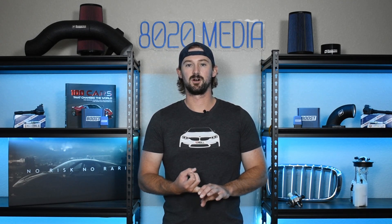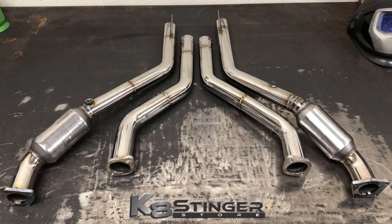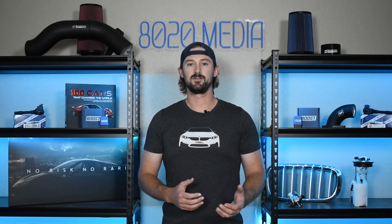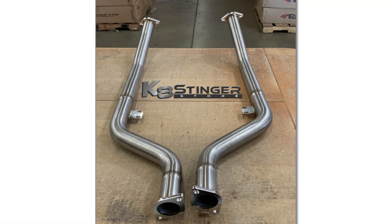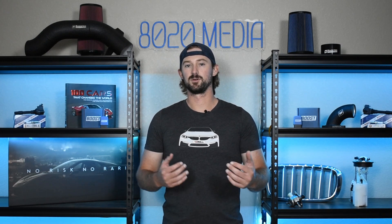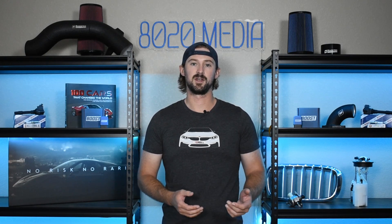You're also going to take a ton of pressure off of the turbochargers, making them more efficient and therefore making more power. The Stinger has two sets of downpipes — primary and secondary — and they do house catalytic converters. Removing them is not legal from an emissions standpoint unless you have a race-specific vehicle. However, going completely catless is going to give you the biggest power gains. There are also options for high-flow catalytic converters, and you can opt to replace only the primary or secondary ones. Going with a catless race setup on both primary and secondary downpipes, you can see upwards of 40 to 50 wheel horsepower just from removing all that restriction.